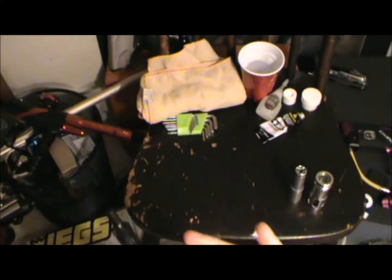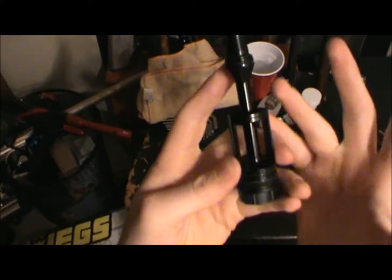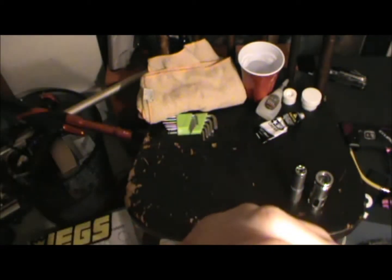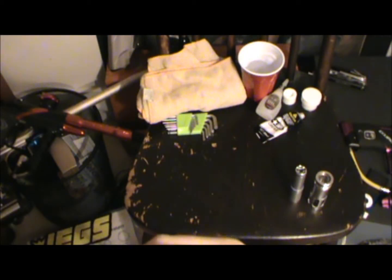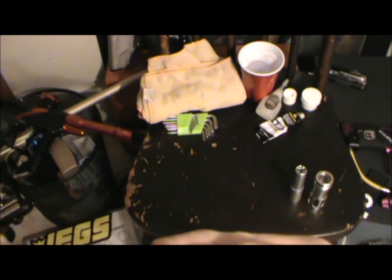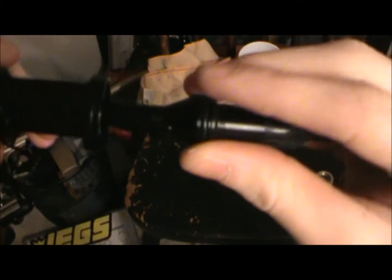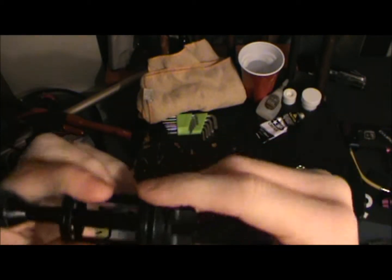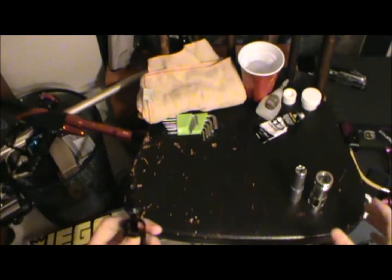Go to the prop shaft, and there's only one necessary O-ring on the whole prop shaft that you need to get, and that's this one right here. Or is there two there? I don't know, it looks like one. And then throw that on there. Yeah, there's just one. Just get that all around there. And that's plenty. You can throw some on the back, I guess, if you wanted to make it easier to screw in, but there's no necessary reason for that.